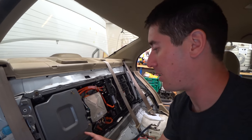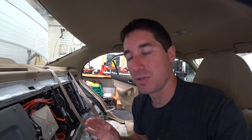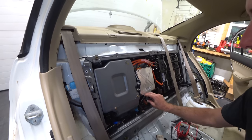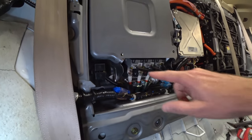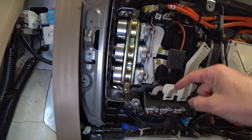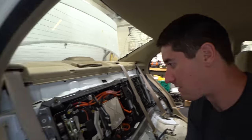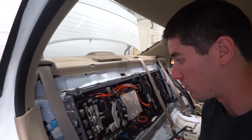Pulling the cover off the inverter section — the actual inverter. There are also sensors we need to disconnect wires from the MCM to check their inputs. If sensor B is actually bad, I've heard it's probably a wiring issue. To fix it properly you'd basically have to pull the transmission out of the car, which is way too much work for a simple flip. With the bottom cover off we can see the three phases coming from the motor up front — supply and return. There are current sensors with the leads going through them, some big capacitors, and the battery connections. Everyone on the forums said it was a wiring issue, but I've been through it and it doesn't seem like anything is failing.